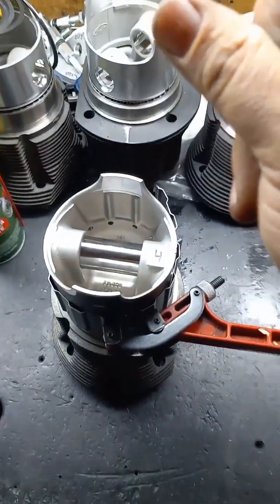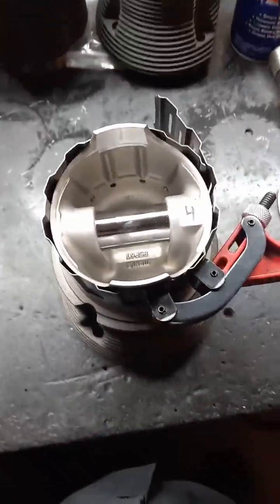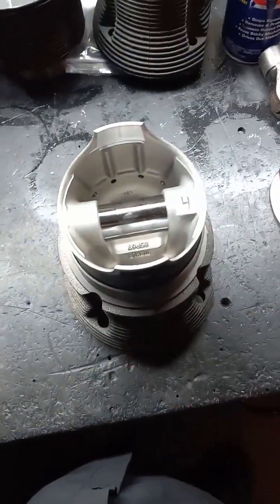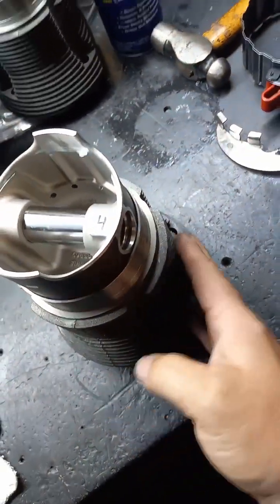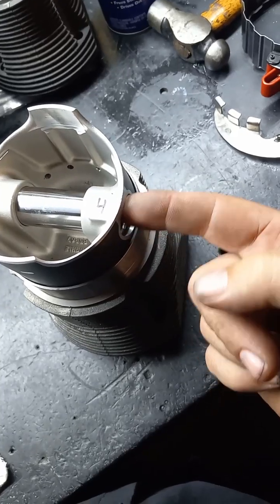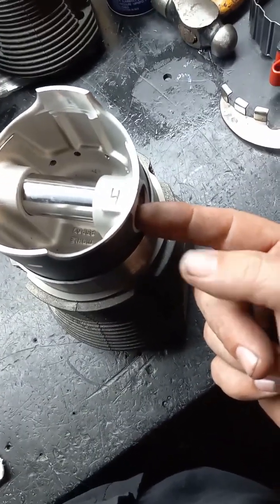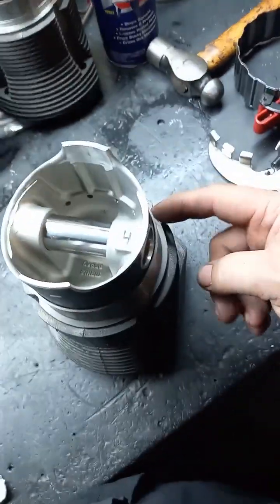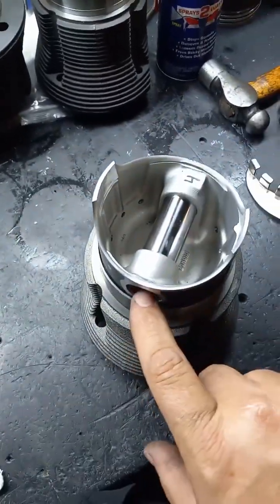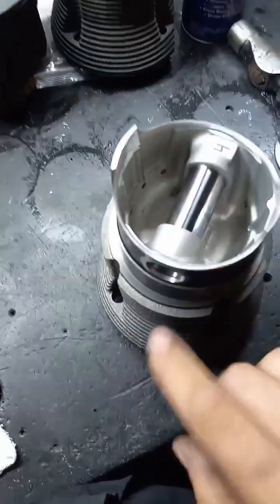So I will put this thing together and then fast forward. There's supposed to be an art form to this. Okay, so this is in there. Basically this would be your best time — on your flat side you would put your button or your clip, your circlip, or if you're using stock ones, put your stock one in here. Is there a downside to the stock one? Not on most applications — usually most RPMs and everything, you'll be fine. So when you take this and push it in the case, all you got to do is slide this guy out and push it in the wrist pin. You're going to oil it and do all that, and then you can put your clip in.